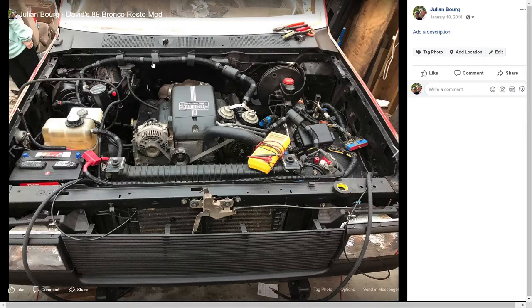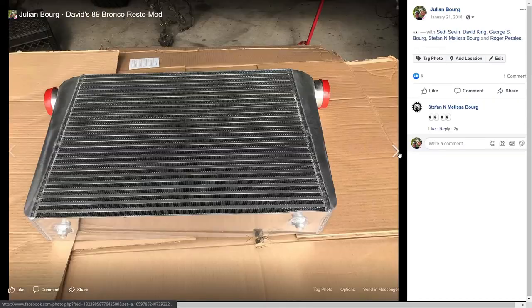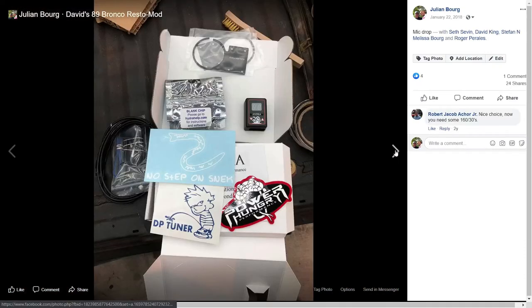This is the three-inch downpipe we put on — we got rid of the ovate down pipe and put in this three-inch round. Here's the comparison between the two: here's the pancake, and here's the three inch. Here's also the intercooler we bought for the truck — the '96 F-250 is non-intercooled, which leaves a lot of power on the table, especially in the heat of South Louisiana. And here's the other performance mod: a hydra tuner. All of our tunes were done by Poor Boy Diesel.